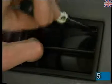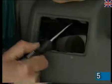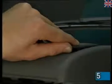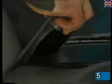To remove a loudspeaker grill, it's necessary to first pull out the fresh air grill. Next, remove the vent securing screw and pull the vent out while releasing the plastic clips. Now slide the inner vent over to one side to give you a little more room. The plastic catches which retain the speaker grill can now be released while lifting it upwards. The inner edge of the speaker grill should be lifted first as the outer edge is secured by small hooks.